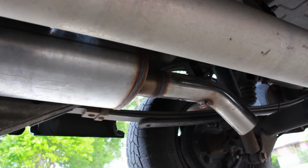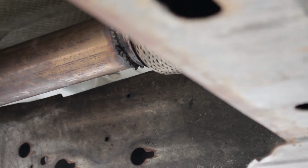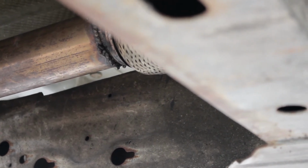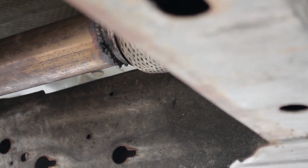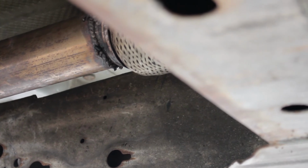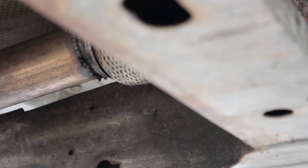It's kind of annoying and it doesn't sound too good. I wish we would have got to it while we were down there. But yeah, that's where that exhaust leak is at, on that piping. The weld is pretty nasty, but at the time, one of my buddies did the weld. We didn't have, number one, the right metal on the wire. And then number two, we didn't have any gas. He happened to run out of gas. But since we couldn't pull it out, we couldn't really TIG it. And it would have been kind of hard to get up there. And the TIG stuff wasn't long enough from the garage. So we just used the MIG, and yeah, that's what happened. So there's quite a few pinholes in there, and you could definitely hear it when I get up on it.